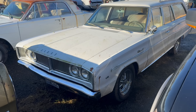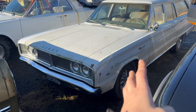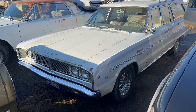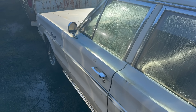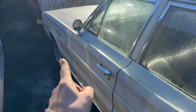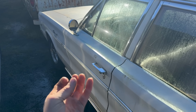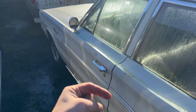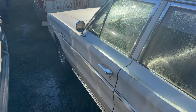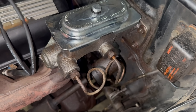There's a big advantage to having that shuttle valve in the event of pressure loss, but you don't actually need it. If your rear brakes spring a leak and all of that fluid disappears, the pedal is going to have excessive travel, but the front brakes should still work even with all of the fluid in the other side gone. A simple way of plumbing the disc swap is to leave the factory splitter from the drum brakes in place, take the rear brake connection off of it, plug that port, then take the line off of the master cylinder for the rears and go straight to that — except between the two, you install one of those hand-adjustable proportioning valves. That way you can turn down the pressure going to the rear brakes and prevent lock-up. You do not have the shuttle valve or brake warning light, but you do still have the redundancy of the dual-circuit master cylinder. The real beauty of this setup is we just kind of have these parts, so it's a very cheap swap.